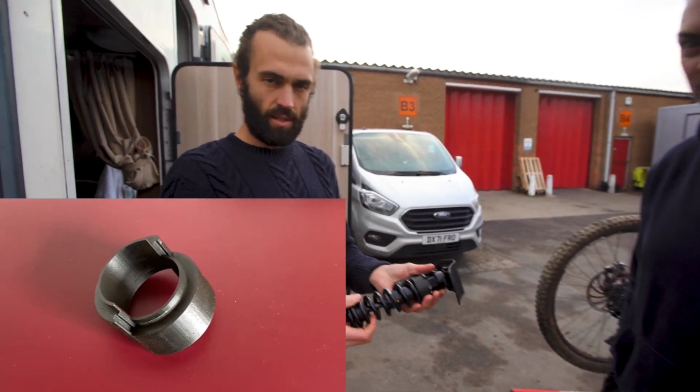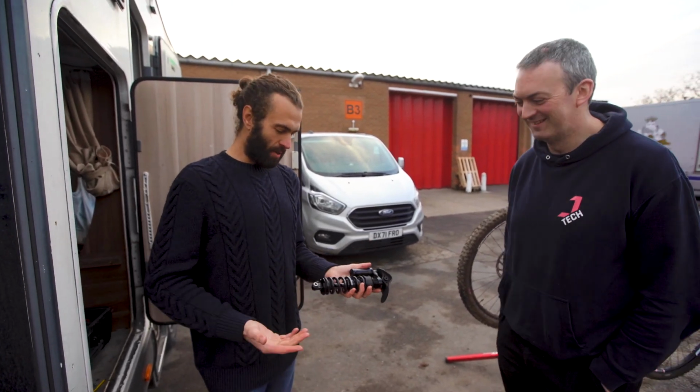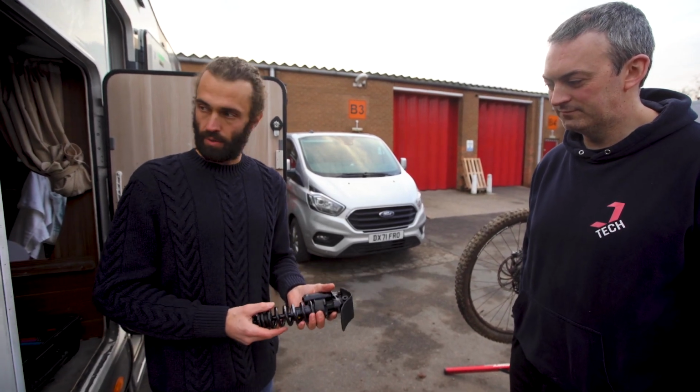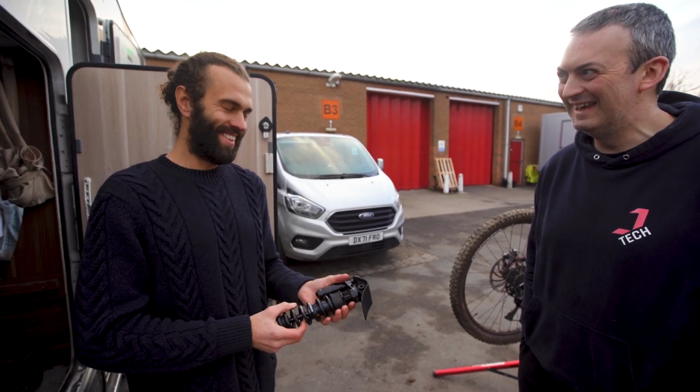Yeah, this is another reason why you should use a reputable suspension tuner. Make friends with them. Get to know them, keep going back, because we just changed the spring because the existing one we had was too firm, so we can just chuck on one from stock, double check the sag before we pay for it, hopefully.